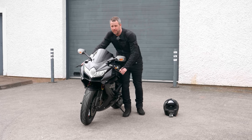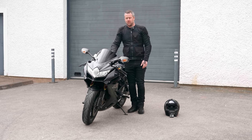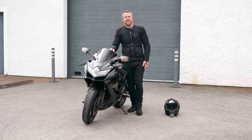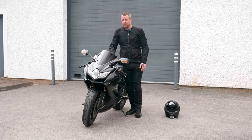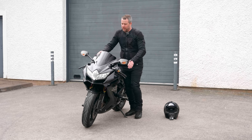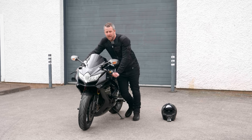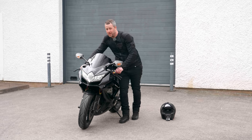From a safety point of view, the biggest risk with this particular trick is it toppling over that way. Some of you guys might have seen Marquez topple over while he's trying to bump start — that is avoidable, but only by not getting too straight with your run. You always need to keep the bike at an angle. I'll put the GoPro on and we're also filming it so hopefully you can see exactly what I'm doing.